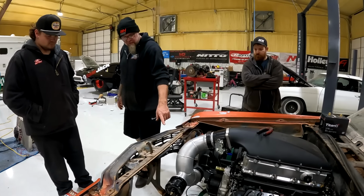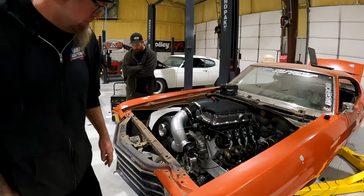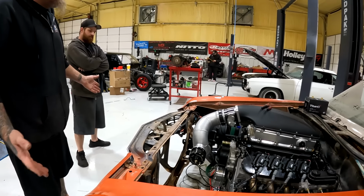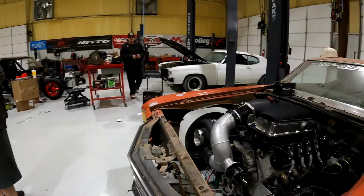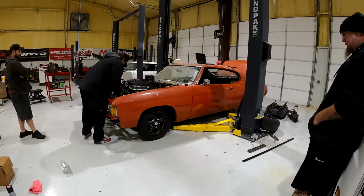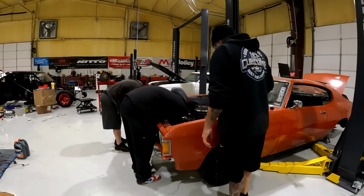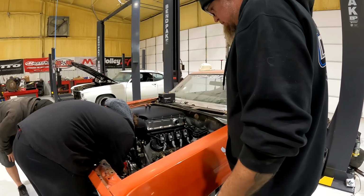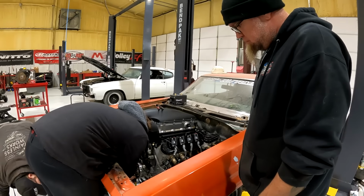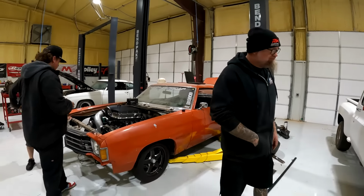Aiden, get a tape measure and tell me how far the crank is off the ground. And it better be 16 at least. Oh, it's at least. I think the ride height of the car is still going to come down. Now, when you measure from the crank, do you measure from the bottom? Not if you want that crankshaft up. That don't look bad to me. The front of the car's got to come down another inch at least. 16, 17? 16 inches. Exact.